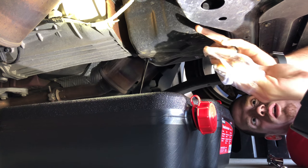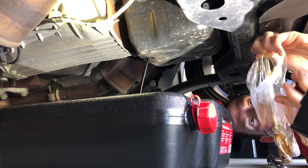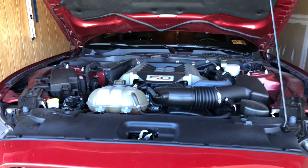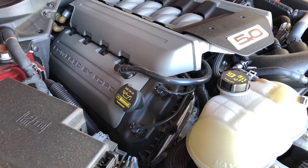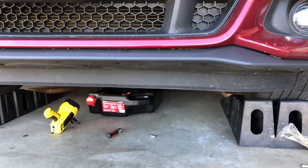What I like to do is take my glove and put it over the bolt like that to keep it from getting oil anywhere. Back above the car while the oil is draining, it's a good idea to go ahead and open up this cap to allow some airflow and let the oil drain out a little faster.